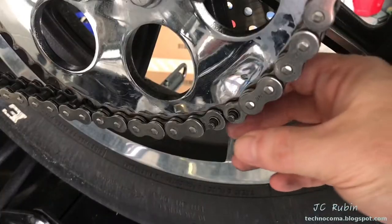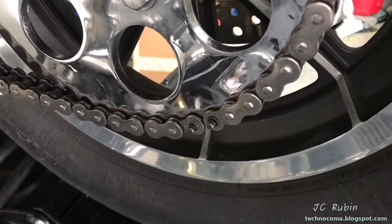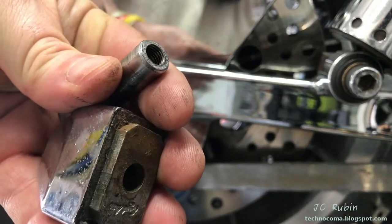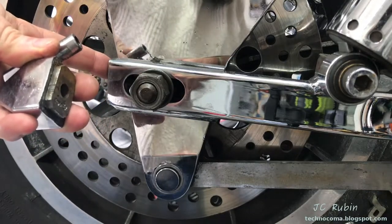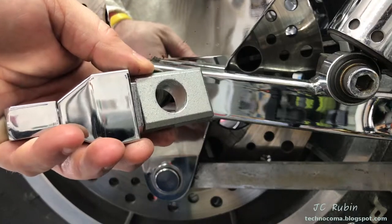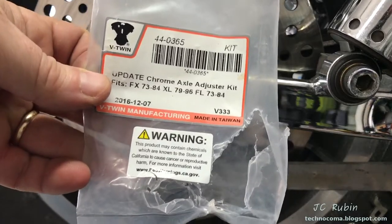So we can lock that down. If I did want to retest this later, I have a special 20 thousandth spacer I could put right here behind the pulley to bring this out and shore up this side. I've got a feeling this will be taken up when the clutch hub is torqued down. I'll loom the chain back through the tranny sprocket, bringing it back around to the rear, and temporarily connect it together at the sprocket of the rear wheel. Several videos ago the chain tensioner snapped off — I've bought a replacement and now is the time to fix it.